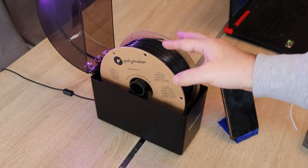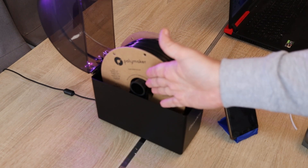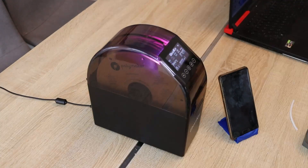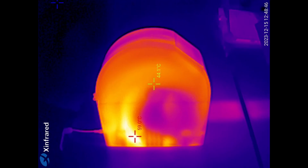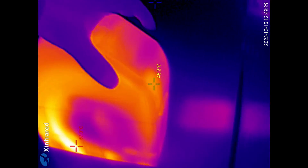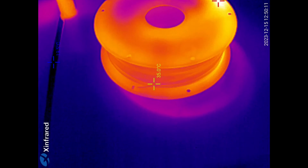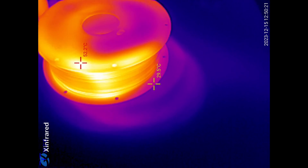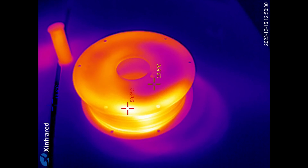One more thing I want to check: how equal is the heating of the filament. This is Polymaker's PC ABS filament, and I know these cardboard spools can withstand temperatures up to 100 degrees Celsius — specifically the glue on these cardboard spools. In theory the hot air goes in a circle and part of it should exit from this hole. I will start heating at maximum temperature and then check with a thermal camera after 20 minutes. The hot air does go in a circle but it is still stronger on the back side compared to the front. After approximately 15 minutes, the top side is around 38 degrees Celsius, the cardboard spool bottom is a little hotter at 53 degrees Celsius, and the filament temperature is very similar — so there are some differences between bottom and top, requiring rotation every hour or so.